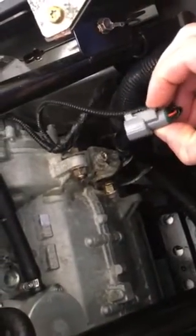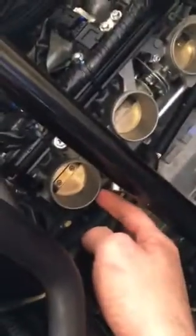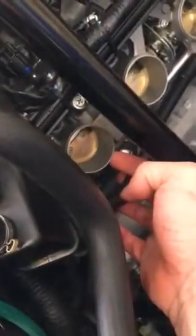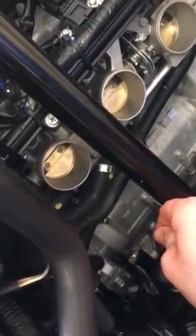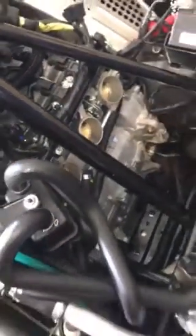The air temperature sensor is a little tricky — they always are. I have to push on it quite hard and then give it a little tug and it'll come right off. The other thing that bothered me was the boot that connects to my carb close to the exhaust — the hose clamp screw was facing the wrong way and it was impossible to get to. I barely got it with a long flathead screwdriver. The other ones I was able to zip off quickly with a socket. Check yours out and let me know if you have any pointers. Thanks.